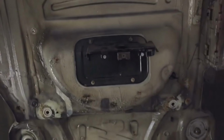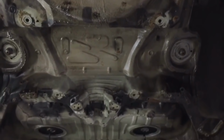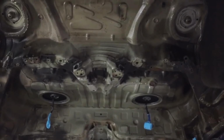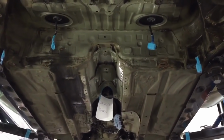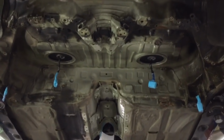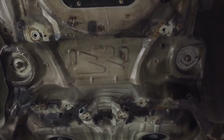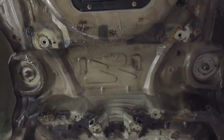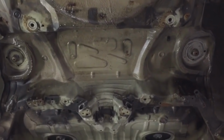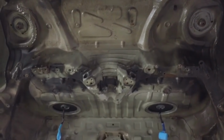The CSL is now fully stripped underneath, with the exhaust and heat shields and V-brace and under trays and axle, and fuel tank and prop shaft, brake lines, fuel lines, all removed. Side skirt's coming off next, and we're just starting the degrease process. And you can see all the dirt on the floor that accumulates over the years. Little bits of corrosion as well around the subframe mounts and where the fuel tanks rub on the front of the rear axle carrier panel.